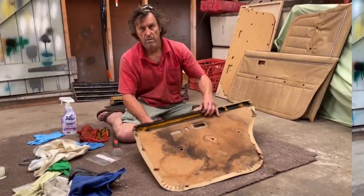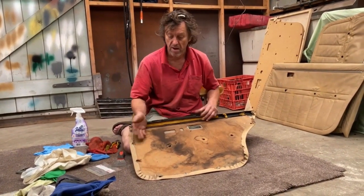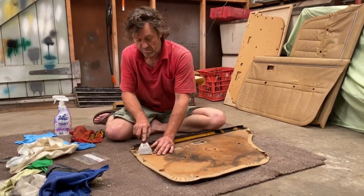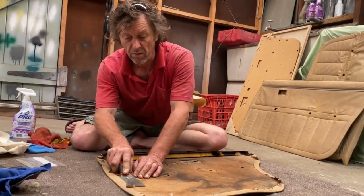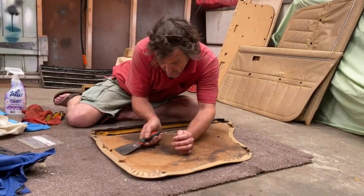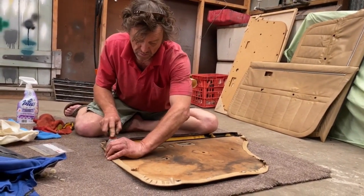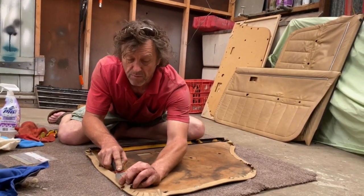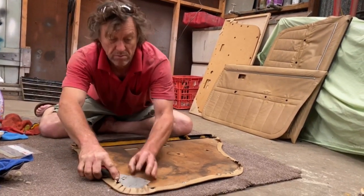These door trims have a metal top section which is clipped to the masonite, and then the vinyl is glued over the edges. To get things apart, I need to get the vinyl off the door card without damaging it. That's actually not too difficult with a door trim that's 40 years old - just a Bunnings or hardware shop scraper. A tip for young players: don't work out towards the edge because chances are you'll go through the vinyl - always work along the edge. They're not stacked up in wrecking yards anymore, so be careful you don't go through the edge of the vinyl. You can do this on the garage floor at home.